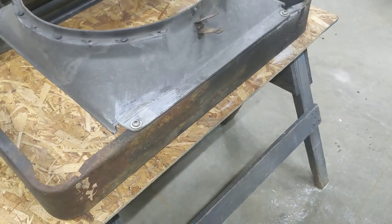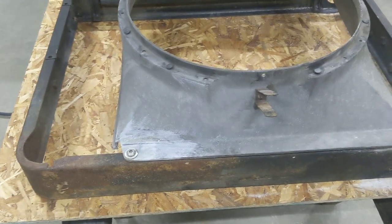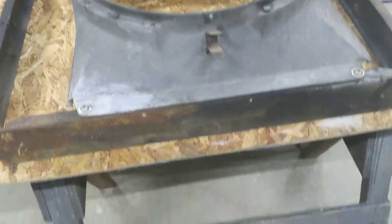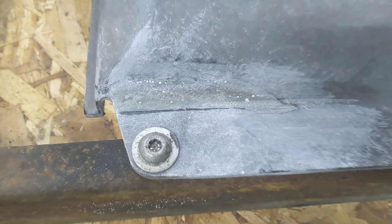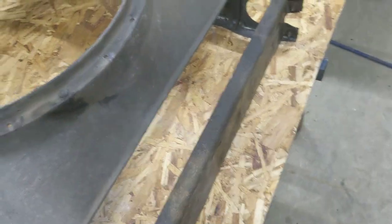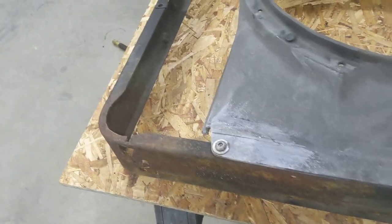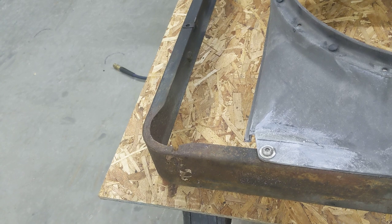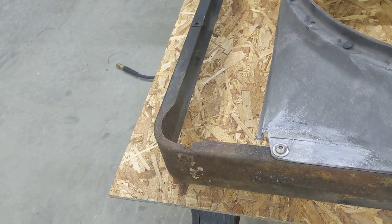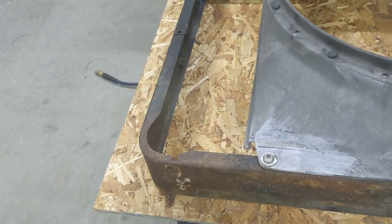Hopefully I don't have to take the radiator out again, but I'm going to do his little hack since I've got to do some welding work on this thing anyway. You can see there's my repair, and basically I have everything bolted together to just kind of hold its shape. Then I'm going to take an angle grinder and cut that metal out, fill it back in, and then make a couple of marks and split the core support to make it easier for future repair.